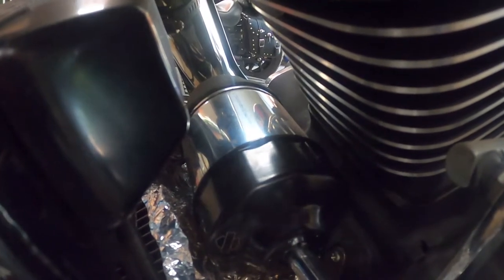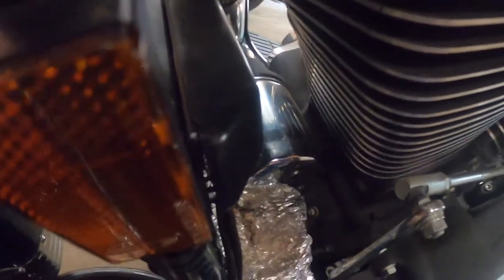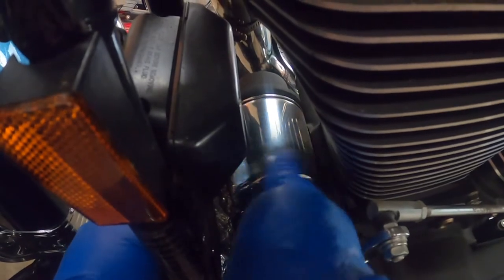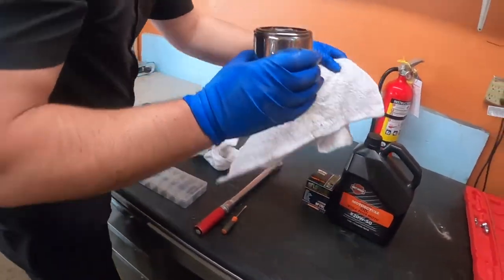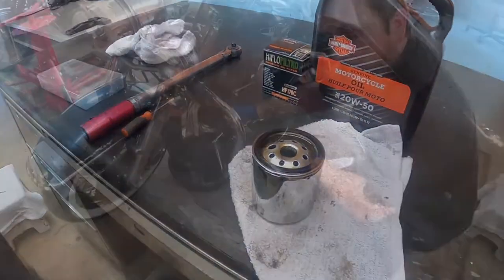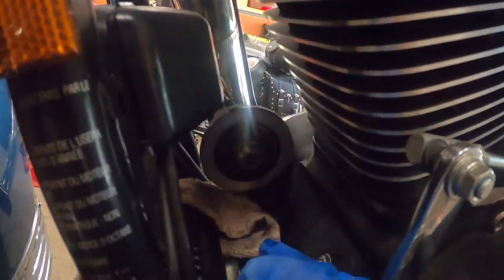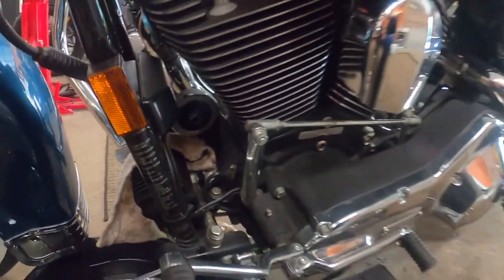Once you make it all the way around where the cutout is against the engine, you can remove the tool and remove the oil filter by hand. After you remove your tin foil, place a rag underneath because there are still a few drops coming down. If there was any spillage, wipe it off now because once the oil filter is on, you won't have room to get your finger in. Just keep it nice and clean.